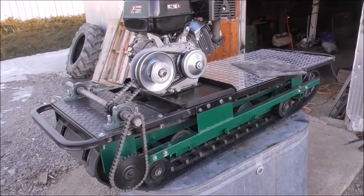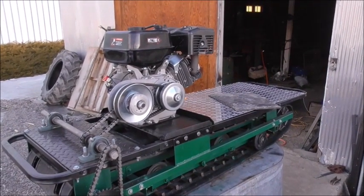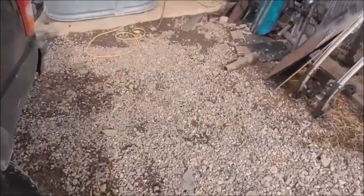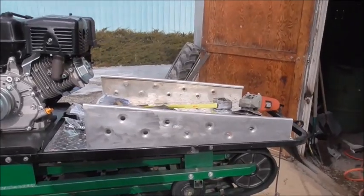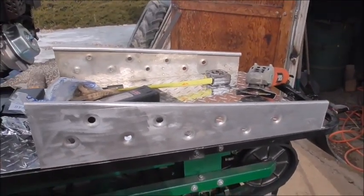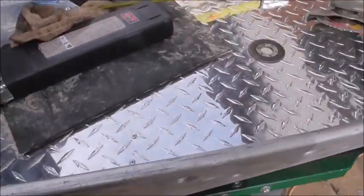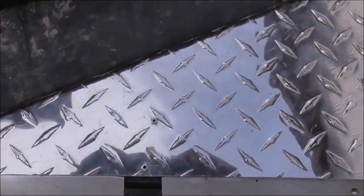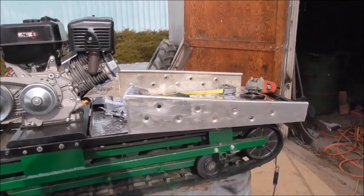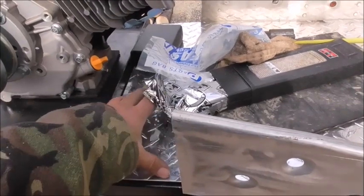I'll build the handlebars so I can try this thing and worry about the flex if it becomes a problem later. I got to looking at the tunnel and running boards from the old snowmobile and found a use for them — they're going to make a pretty good little box. They've got a rounded edge and some holes to let the snow out. I'll cut them up, tuck them under the edge of the diamond plate here, pop rivet them down, and put some ends on them. That'll make a nice little box for gear.